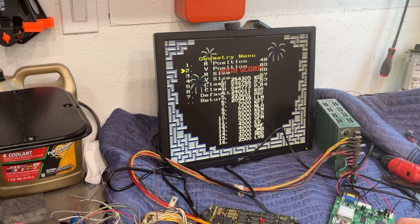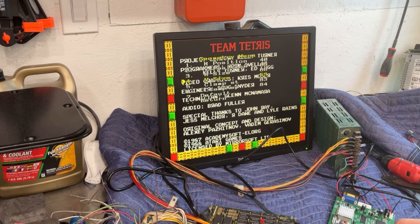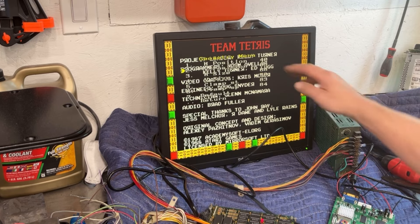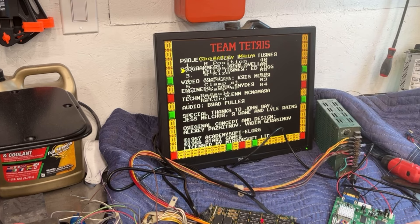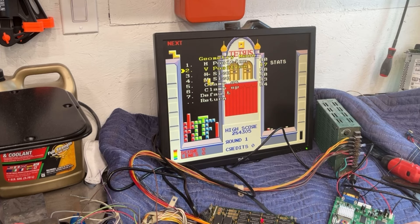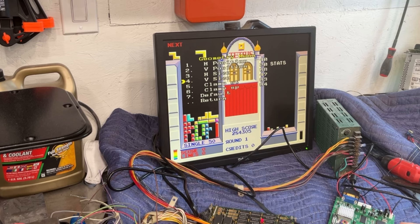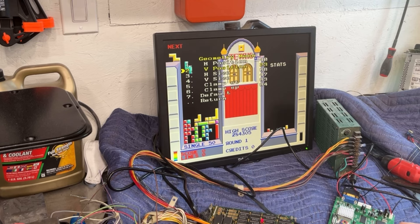There's a slight wiggle at the top of the screen — that's what I'm talking about. Let me touch the two sync wires together to see if that does anything. Sometimes that'll help, but it's not doing anything. Let's get back into the menu and go to clamp settings. I had them set at 83 and 84 for a different game; normally I think they default to 95 and 5. Let me try switching those values and see if the wiggle clears up.